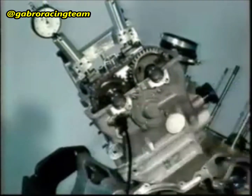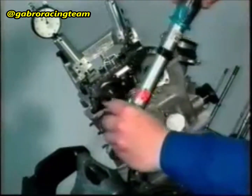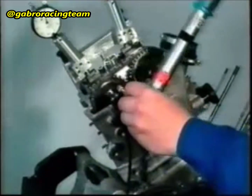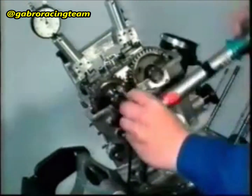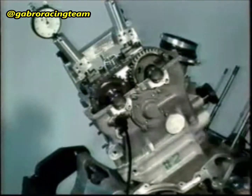Follow the same procedure for the other M6 by 16 visible tube-headed screw, quality 12.9. Use a new tube-headed screw also in this case. The tightening torque of these two screws is 20 Nm.